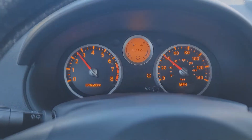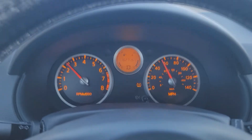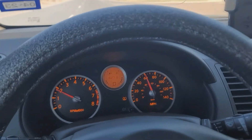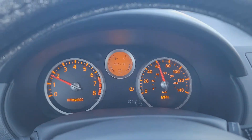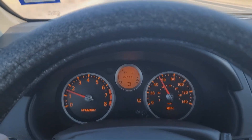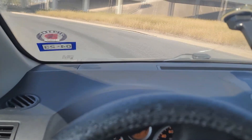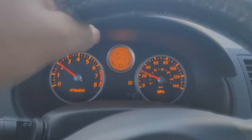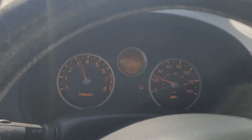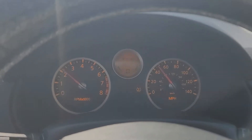You can see now it's adjusting — we're at 40 already and it's already dropped the step. There you can see we're at 60 miles an hour and we're at 2100 RPM. You gotta make sure you keep that little lever correctly — that was the problem. You guys are getting a P1778 because you've blocked off that lever incorrectly. You can see the transmission is adjusting properly. It was stuck at 3000 RPM at 40 miles an hour before, but you can see now it's adjusting the way it's supposed to.